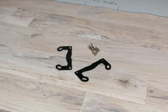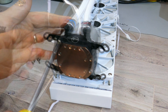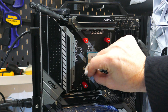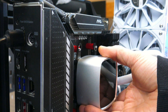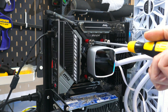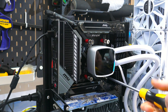With the radiator installed, find the AMD mounting bars and slide them into the block until they align with the screw threads, then use the four provided screws to secure them. Clean the CPU with isopropyl alcohol, apply thermal compound to the IHS, remove the sticker from the cold plate, and place the block cold plate down onto the CPU. Align the mounting bar holes to the standoffs and use a PH2 screwdriver to fasten the four spring retention screws in a cross-diagonal pattern.